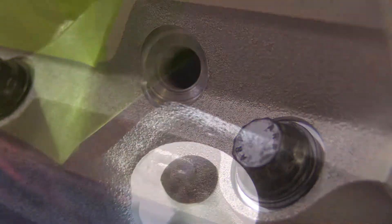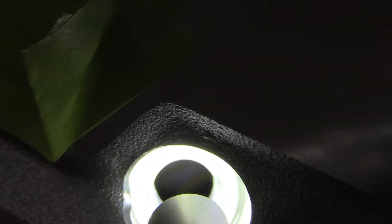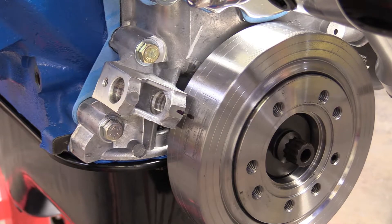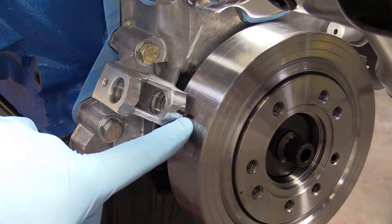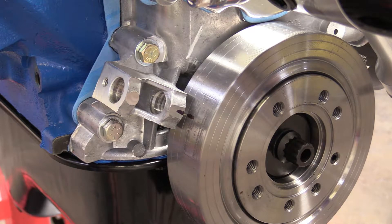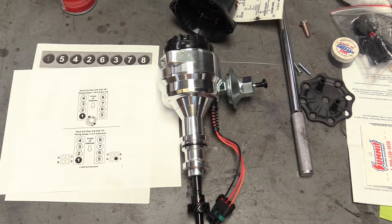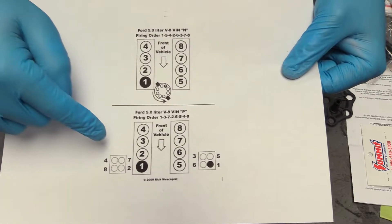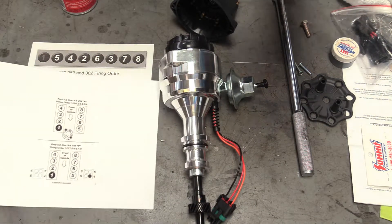I know that's really tough to see down in there, but you can kind of see my signature from earlier — that is at the very top of our cylinder, so we know we're at TDC on the compression stroke. On Fords, it's not uncommon for these Windsors to not have timing marks. There are kits you can buy with a little pointer that points to where the zero is, but we made our own since ours didn't come with it. With Ford small blocks and big blocks, they have different firing orders. For this Ford small block, there are two firing orders, and I've printed out a sheet describing both.